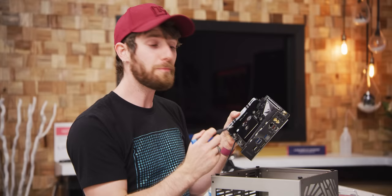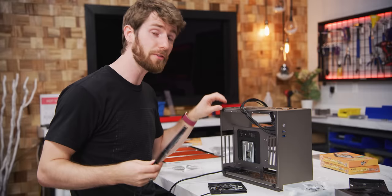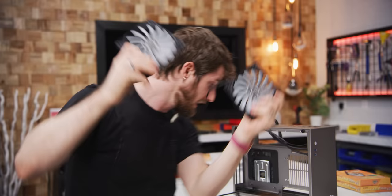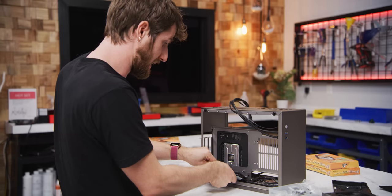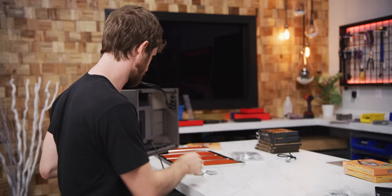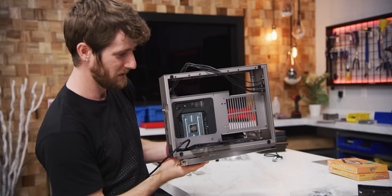Our finished build will have plenty of room around the CPU, so we've gone with the EK Velocity Strike RGB. What we need to do first is get two of these Kaze 1212 crazy slim 120mm fans installed in the bottom of the case, paying particular attention to cable orientation, over on the motherboard side. We're going to use these as intakes, both for the case itself and to cool the radiator that's going to be in the bottom of the case. We're going to put the rad here and use the fittings as feet.